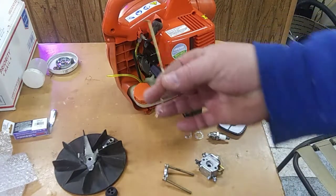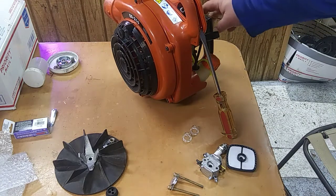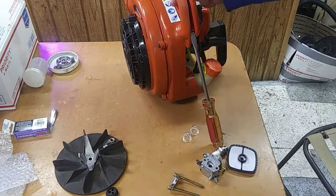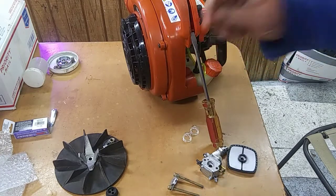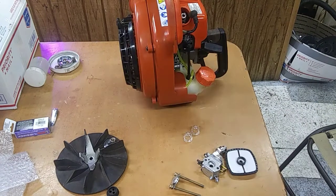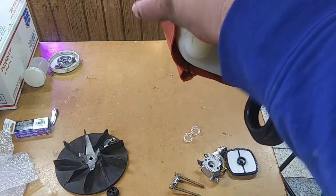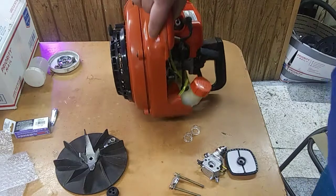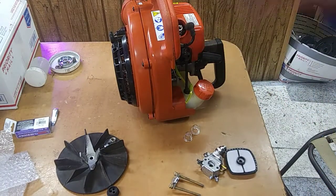So I'll get that done. By propping it open like that with a flathead screwdriver, I can see the little lever in there — it's moving up and down. You just gotta work it from under here and slip it in the hole on the end. Alright, so we got it up in there; you can see the trigger moving. Now you just gotta get the carb on without knocking that back off. I'm not gonna put the screws in, because if I knock it off, I gotta take them right back out.